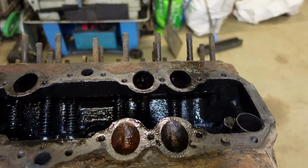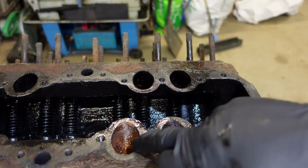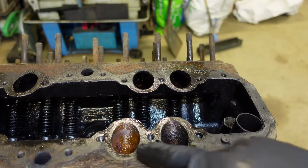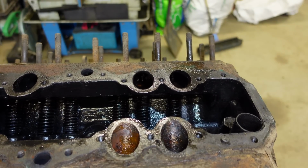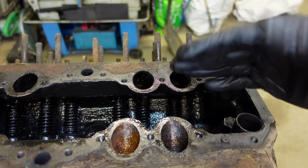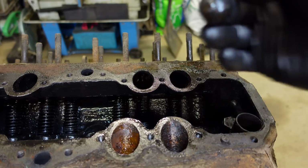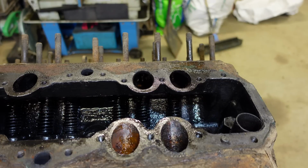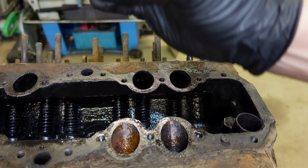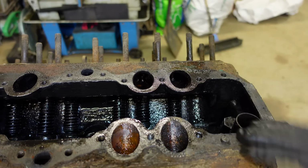I don't know if I showed you this before. You see the rust down that inlet port there. That leads to the actual cylinder that was locked up, and the reason we're pulling this out with the truck, it's got a seam down the middle of the bonnet, and there's no Sikaflex or drip check or anything in that seam, so the water's been dripping through it, and because of the V8, the carburetor's right in the middle, directly under it, and the air cleaner wasn't on it.